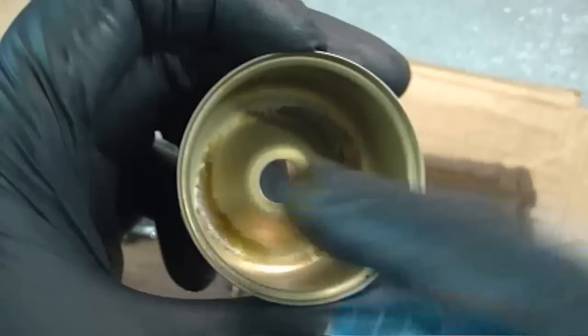If you still have a bit left like this, you can always respray a bit of carb cleaner and basically scrub it off. I usually use my ultrasonic cleaner to do carbs, then I don't need to do this. But I know that most of you guys don't have one, and most of my videos are actually made for the DIYers. And most of you guys don't have all these expensive tools. And now you can just basically wipe off all the other parts.